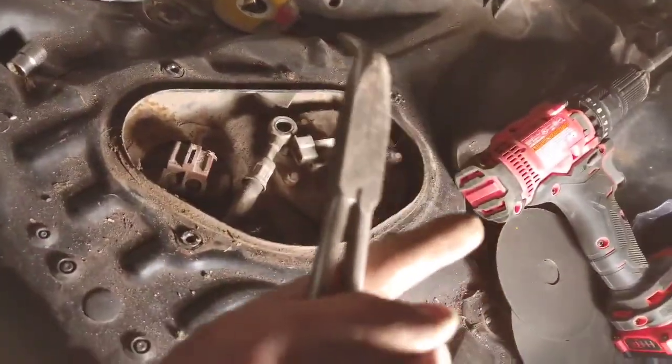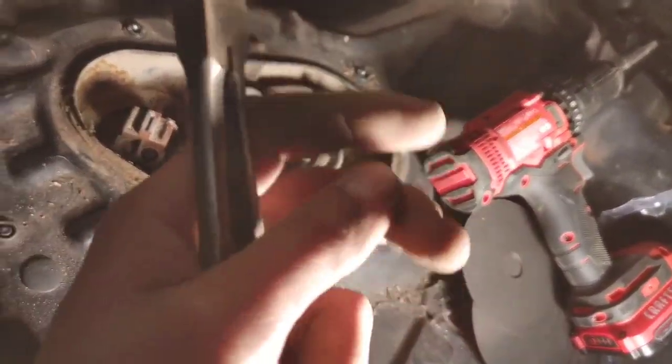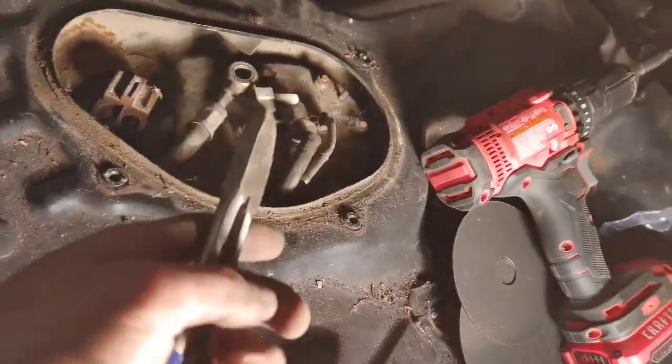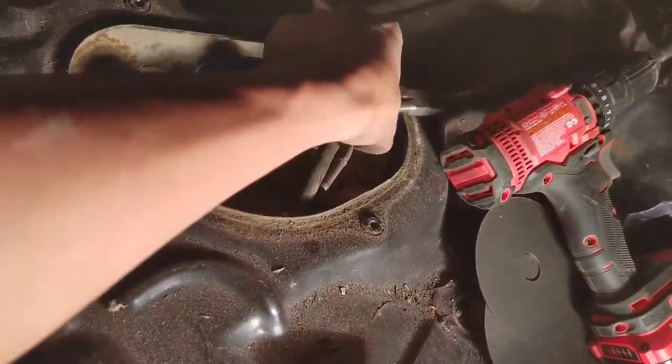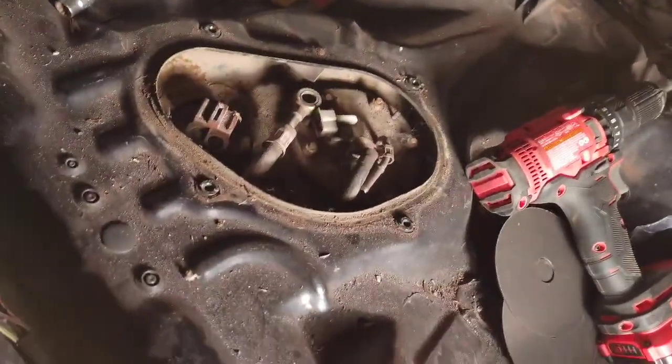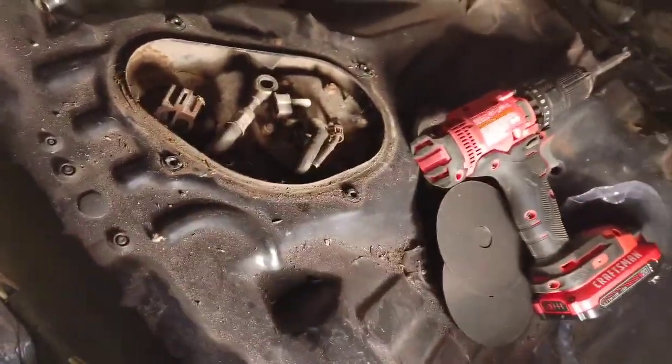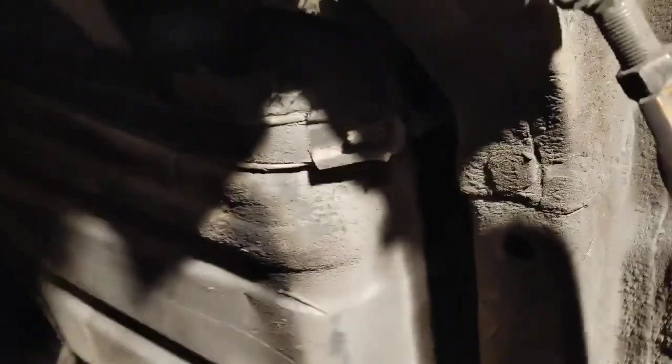Down there, underneath those covers, there is a 10mm lock thing, and then another clamp that you pinch. And then after that, we should just be able to do the straps and drop this tank. I realize I will not be time-lapsing because I really do not like doing that, so I'll just cut clips and merge them together. But I got one set.